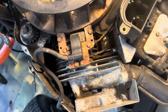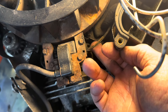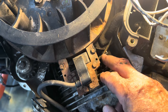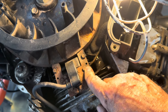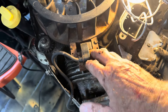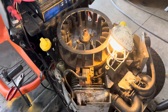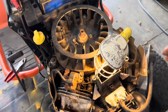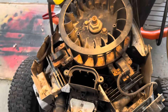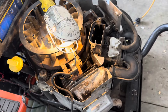You can see the little critters were in there. The ground wire here is chewed up a little bit — this is just a shutoff ground that goes to the electronic switch on your dash; it kills the power to your coils and stops your motor. We're going to have to rewire this and there's a lot of rust on these coils. I listened to this motor today and it was running beautifully — smooth and real great — but how in the heck could they cool it down? It must have been stored somewhere with poor pest control, and critters made it their home.